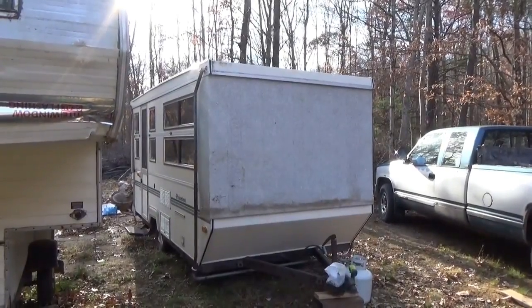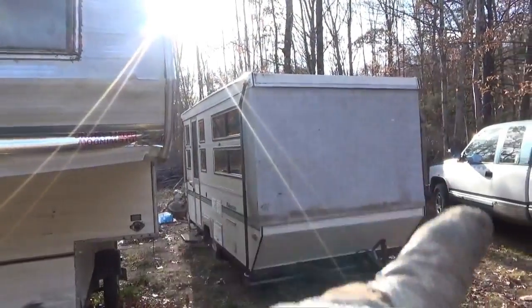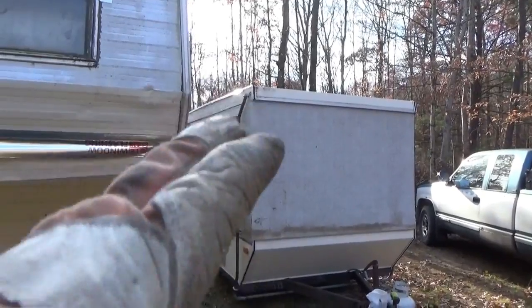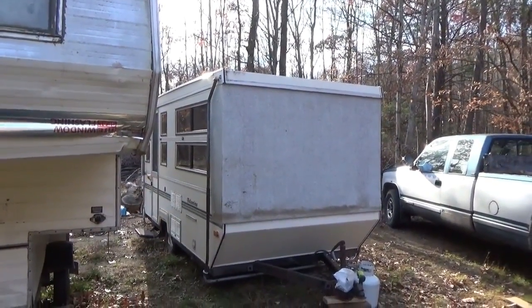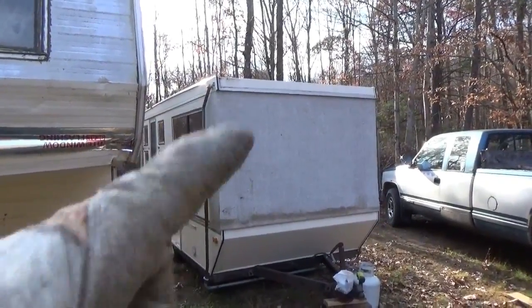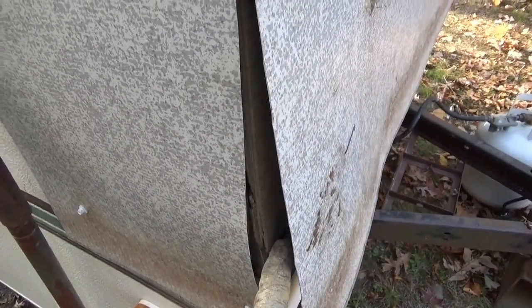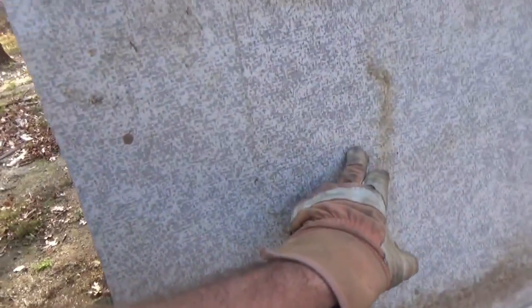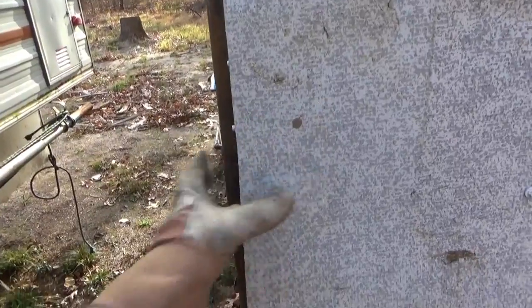Now I'm going to put tar sealing tape on the corner on each side, and then I'm going to get some trim, some like roofing trim, and tuck it in under the lip here and all the way down on each corner, and this will never leak because that sheet metal is tucked up into the roof of the camper, right up inside there nicely, and runs down past my plywood repair job down in here. I haven't tied it in until I get the trim, and then I'll know where my boards end. So I put the screws far away from the edge for now until I get the trim, because the trim is going to be wide, and it'll look good.